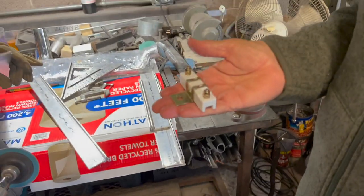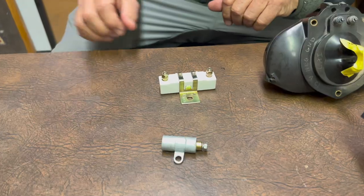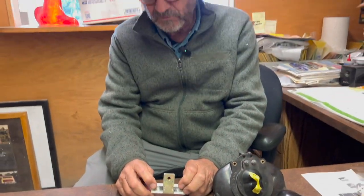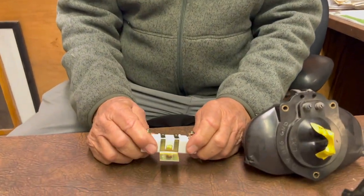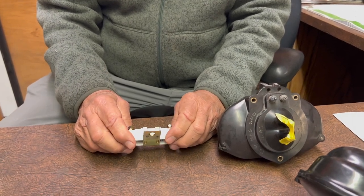What's its function in the car? It drops the voltage. Why is it dropping the voltage? This other item here is a voltage reducer — this is a modern version. They had earlier versions of them back when the car was built, but this is an up-to-date one you can buy from Napa presently. What this does is, since we're using 12 volts elsewhere, we want to make sure that the power going to that coil does not exceed 4 volts. It's not made to handle 12 volts, so you're going to create heat — that's what this coil is for.